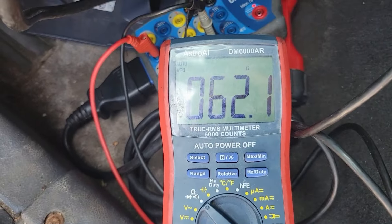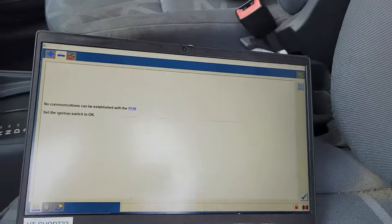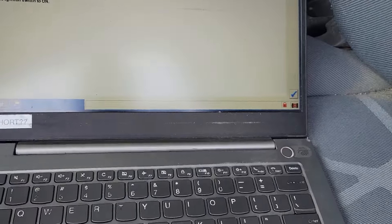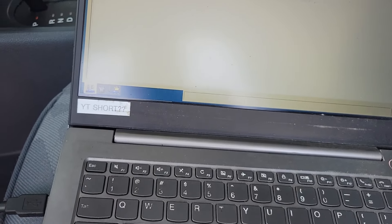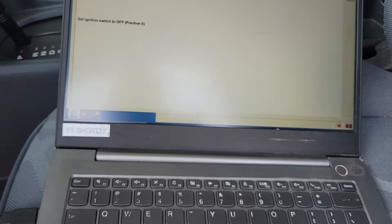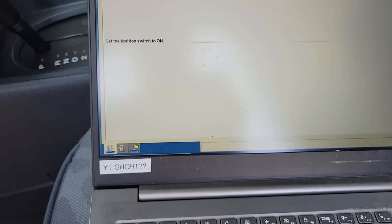I feel this network is intact. I can't say it doesn't have a dirty signal on the CAN bus, but I'm going to go through on the Ford scan tool to continue IDing the vehicle. We want to figure out which modules communicate and which don't. I'll go ahead and get the key to run position, ID by tear tag, and let it ask for PCM calibrations.